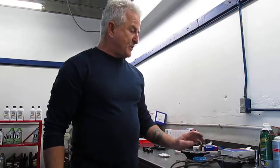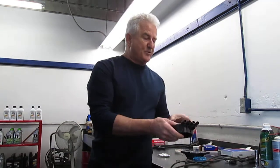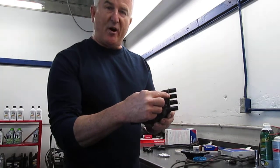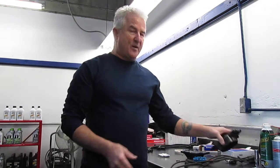A little tip from John Sather: when you're pushing the wires on, look afterwards when you get done installing them and make sure all your boots are flush all the way to the end. It's very easy to not get a boot all the way on and wonder why your vehicle is not operating at the optimal level that it could. Thank you very much and have a great day.